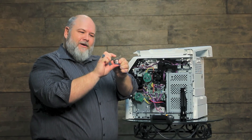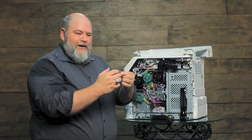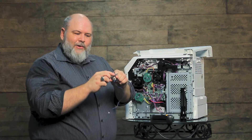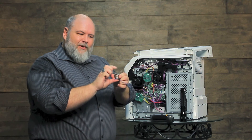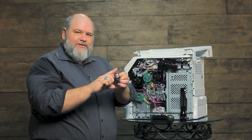Pickup solenoid — you're looking at this arm right here. This is the upgraded pad; it's a black pad. The older style had a yellow felt pad. The yellow felt pads were the ones that were bad about wearing down. These look like they may hold up better — we'll see over time. But this is what we're looking for: if that hesitates just for a moment when you lift up, then you need to replace the solenoid.